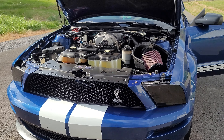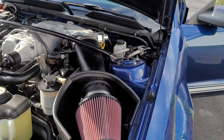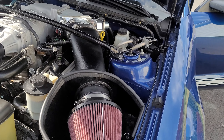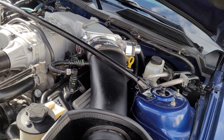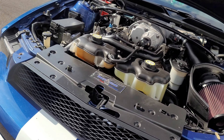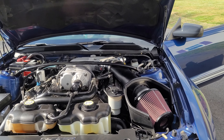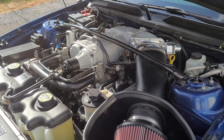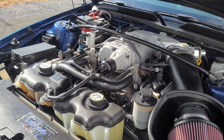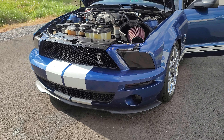With all the issues from that exhaust shop, replacing the O2 sensors set me back a couple of days. Those upstream O2 sensors are not fun to replace. I had to rig up custom modified tools just to get an O2 sensor socket up there. I do not recommend it — God bless anyone who has to do it. With long-tube headers it's a lot easier, but I'm still on factory manifolds and it is not fun.